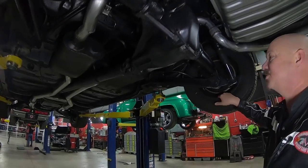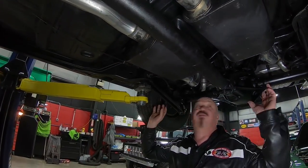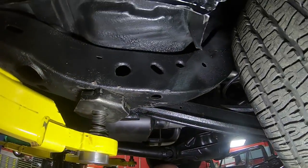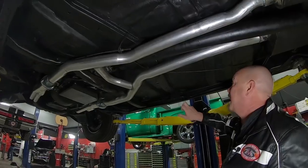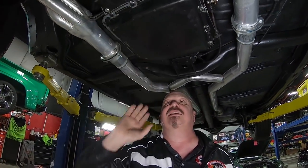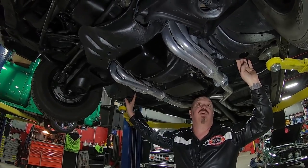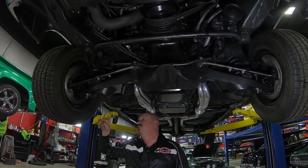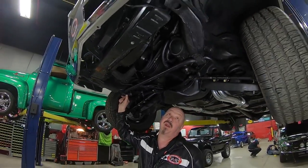Bushings look like they're in good shape. Looks like it's got brand new drums on the brakes and the guys will take all those brakes apart to make sure they're in good working order. We've got Flowmaster mufflers. The frame looks great. I always check out the lower areas in the frame on these cars — that's what you've got to take a look at to get the story. While you're looking at the frame, feel the back side of the rocker — make sure it's intact and nice and smooth. Floorboards look good, the floor braces look good. We've got a crossover pipe for the exhaust. It's got a Turbo 350 trans — a three-speed automatic. It's got jet-coated headers. The bushings on the sway bar here on the frame look good.